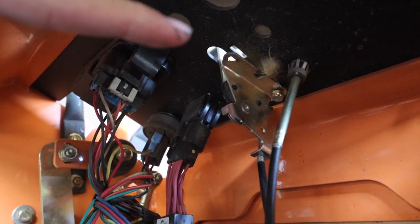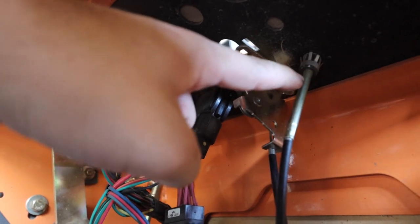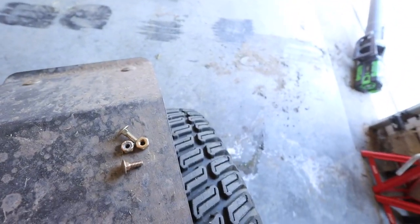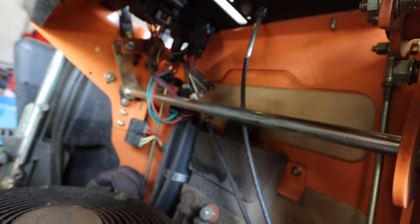Pretty simple — you can see the two nuts there. I've already taken one off, which is right here, and there's another one right there. We're gonna loosen up and then pull this through. As I was gonna tell you to hold on to those two nuts and bolts, I dropped one throughout the mower, but I found it. So hold on to these little guys here. Then we're gonna take the throttle cable, maneuver it down here, and now that's loose.